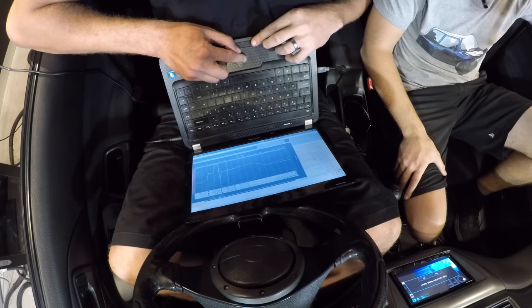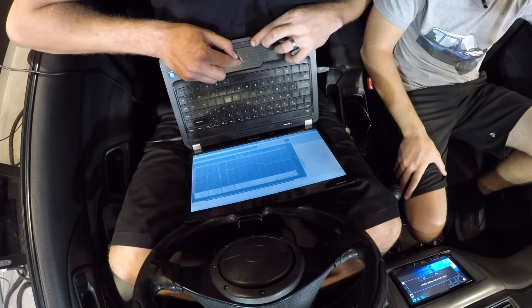We're cool. All I'm making sure of is that our targets are nice and that nothing is changing while we're mucking around here. Because if I see that our short-term trims start to do something peculiar, I think, hang on, is our fuel system got... We're still cool. It's happy. Pump's working, that's good. Pumps are working, everything's good.